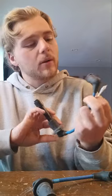This is specifically a how-to for the boots themselves. You can also put some on the outer white part of the spark plug when you install them, to prevent the plug from seizing and getting stuck when you try to remove them later. I don't think that's too important personally, but I'll probably do it this time since I have enough dielectric grease.